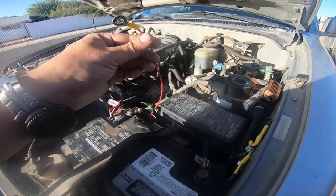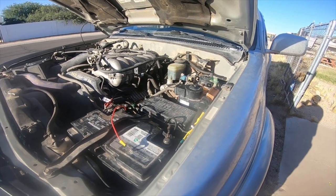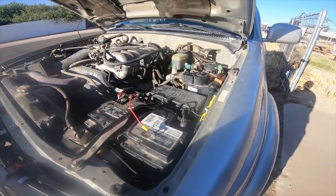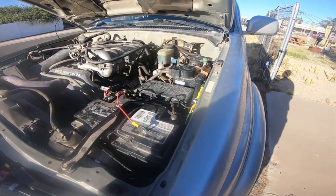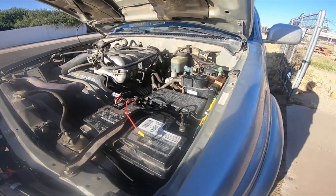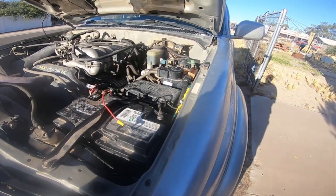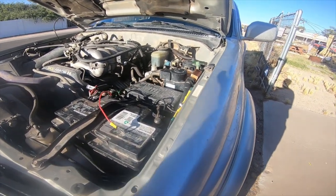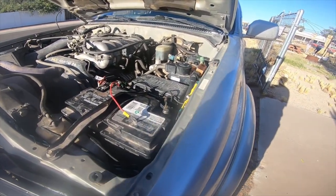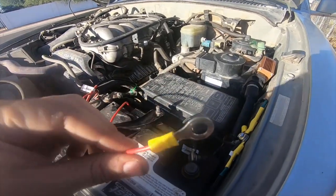I ended up having an issue with the Bluetooth module when I leave it plugged into the battery. Even though I went into the app on my phone and turned all the halos and demon eyes off, when you have the demon eyes set to pure white and then turn everything off, they all turn off — but the demon eyes still have this slight hue. In the dark you can actually see they're on, glowing a dark deep red. They're not fully powered, but they're pulling power from my battery, so I unplugged it.